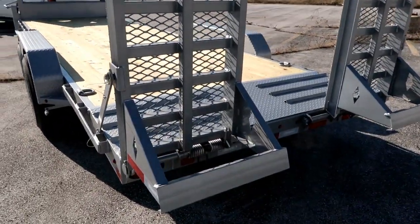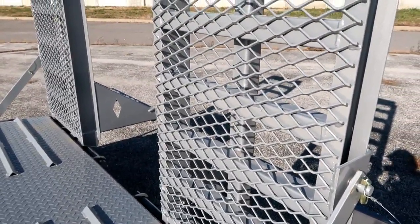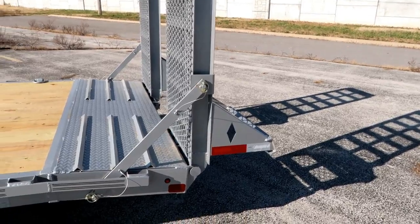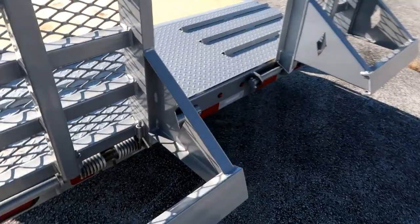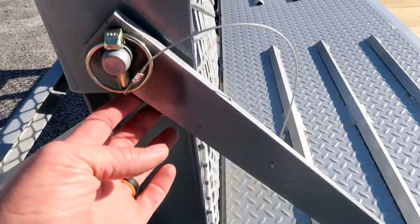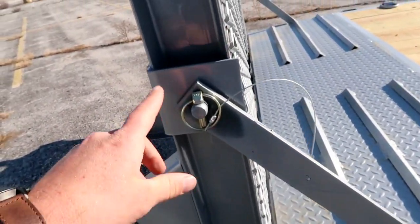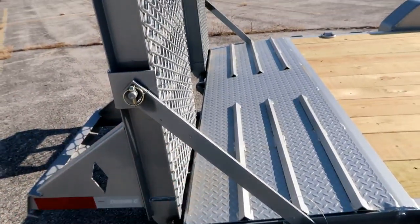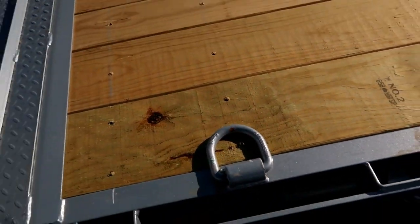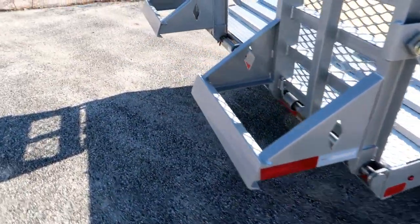This is an upgrade — a 2-foot with expanded metal. Pretty hefty, looks like 2-by-2 square tubing and probably 4-inch channel. Pretty good setup with the drop legs to help with equipment loading so it doesn't lift the front off the ground. On the surface here, everything looks really, really nice — we have the traction cleats on the dovetail as well. Oh, here's a pretty big flaw — we've got a huge spot that got missed with powder coating, and obviously behind this pin got missed as well. These are high-traffic areas anyway — you're probably going to chip off powder coating and it's going to start to rust. But with those high-traffic areas, you're moving chains through there constantly, so as long as you're actively using the trailer, you're going to keep the rust away by continually rubbing those areas.